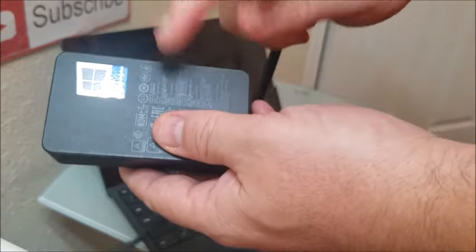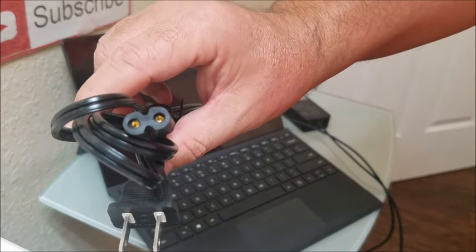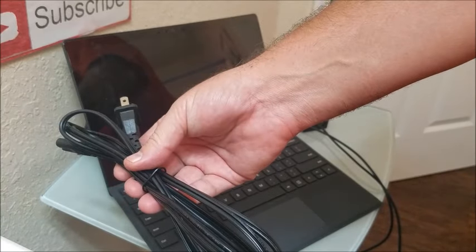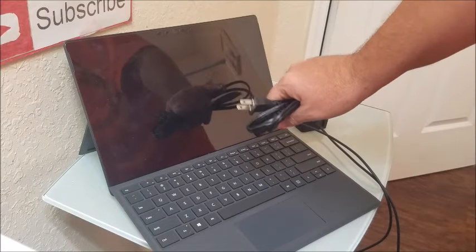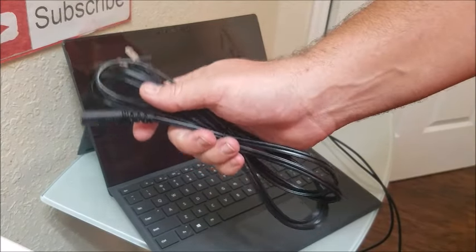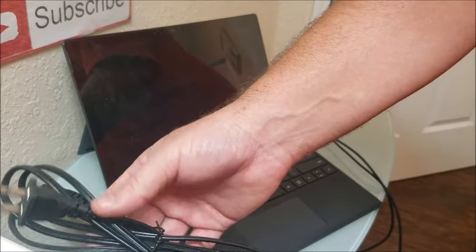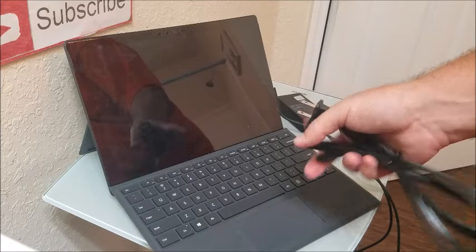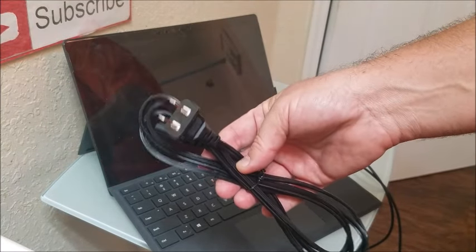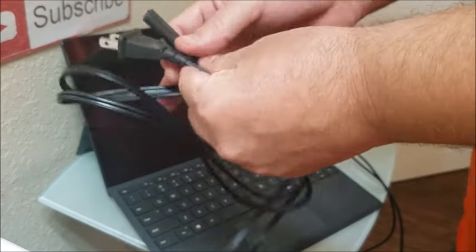What I would do before buying a brick on Amazon or eBay is try to replace this AC part first, because hopefully your brick is still good. You might have one of these figure-eight cables laying around at home — try pulling it out of a Toshiba or Dell power adapter and sticking it into your genuine power brick to see if that fixes the problem. If not, you can get these figure eights for a little of nothing on eBay — anywhere from three to six bucks — which saves you from having to buy a power brick at 30 or 40 dollars. I'll put a link in the description.